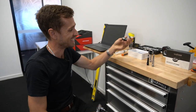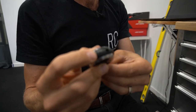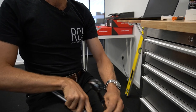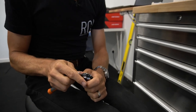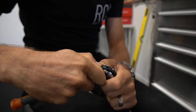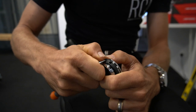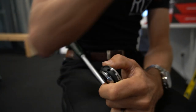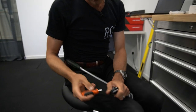On the new Wahoo ones there's a little rubber end cap on the end. Just hold it with an 8mm Allen key — you can put it in a vise if you wanted to. Use a little pick or a Stanley knife blade, like a box cutter blade, and just wiggle that guy out. Try not to rupture it. Then grab a 3mm Allen key.